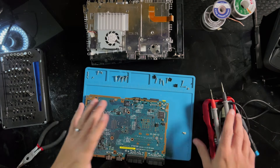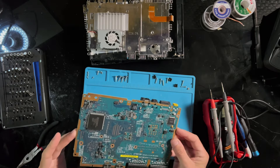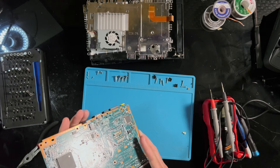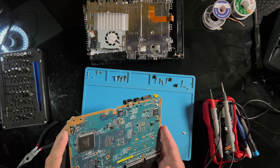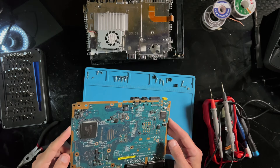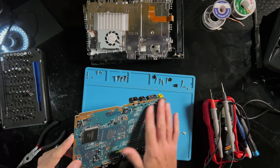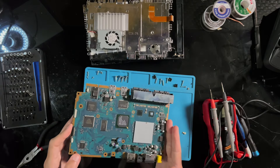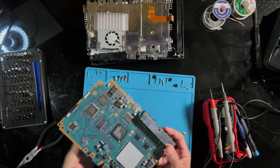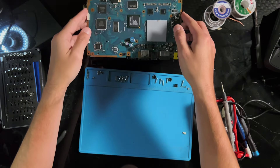I want to replace this with the proper fuse, so I need to order one — I don't have a five amp or ten amp fuse. I don't want to just put a four amp on here, even though it probably would work, because I'd hate for it to blow prematurely. Once we've replaced that, hopefully it'll fix the problem. Won't know until that comes in a few days. For now, we'll move on to the other one that has disc reading issues.